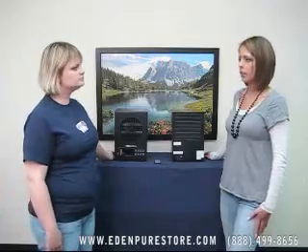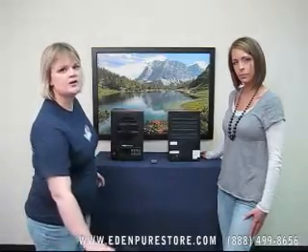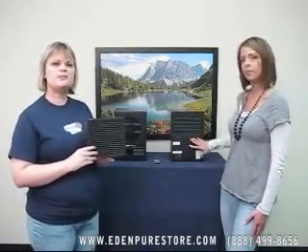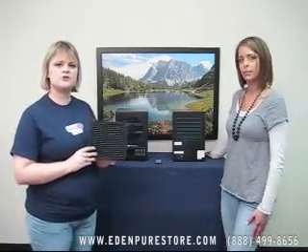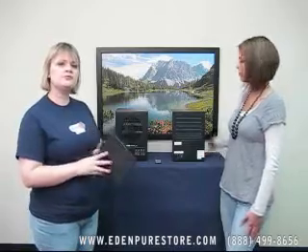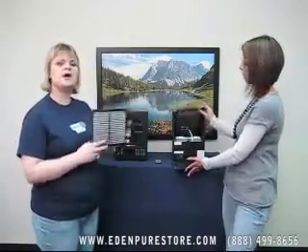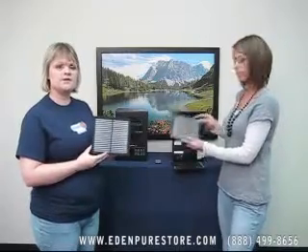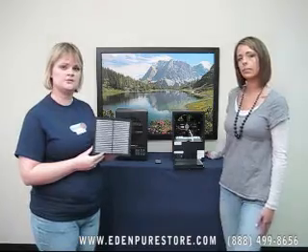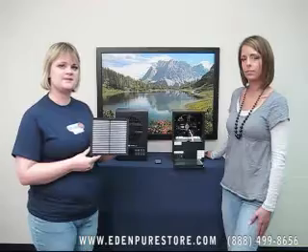Kathryn, let's first talk about the double air filtration system that the EdenPure G7 uses. The first part is our carbon or pre-filter located on the back of the unit. Its primary function is to remove large particulates from the air as well as trap odors in the carbon fibers. If you remove the carbon filter, you'll notice there's another filter inside, which is the second step: our photocatalytic filter. The function of this filter is to remove any smaller particulates not caught in the carbon filter, as well as work in conjunction with the UVC germicidal lamp to kill off germs and bacteria.